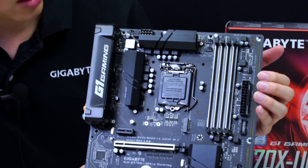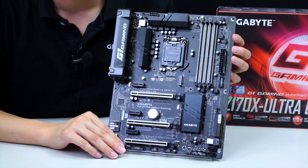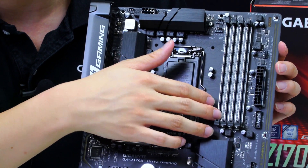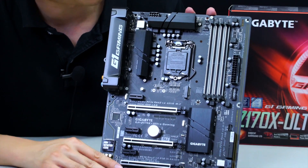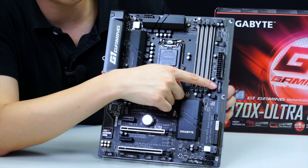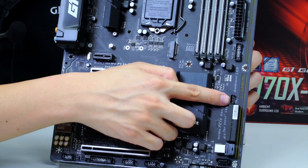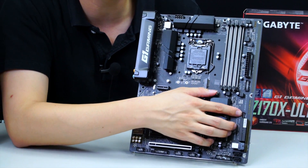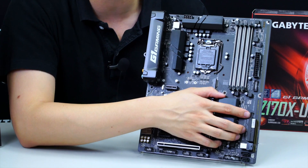On the side of the board there is a green or yellow LED strip for ambient surround LED illumination. We've also implemented diffusers on the DDR slots to allow the light to show even more, with lighting on the top right and bottom left, even on the PCIe slots. Moving around, there's another system fan header, the ATX 24-pin, the USB 3.0 front panel header, and a set of pin headers for Thunderbolt — allowing you to add Thunderbolt ports via an add-in card or front panel bay drive.